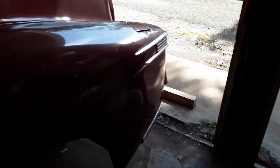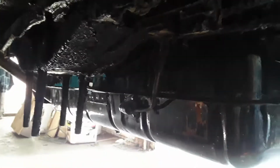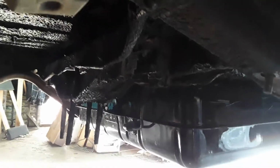One of the things I'll point out here on video today, because it was in the last video I did on this car. Take a roll under here. It's a little hard to see under here, but there is that rear suspension cross member that holds the spring. And these little mounts here, I repaired them and repadded them with new rubber. And we drilled through the frame, through the mounts, the little cross member, and the frame, and installed 4 very heavy-duty safety bolts all the way through to retain that cross member in place. Up until then, the only thing that held it was just vulcanized rubber mounts, which is not good.